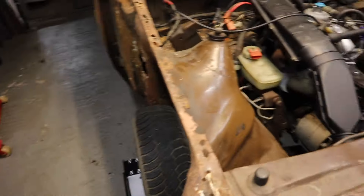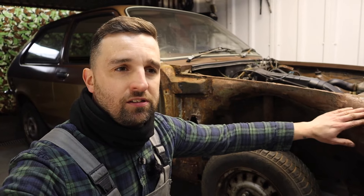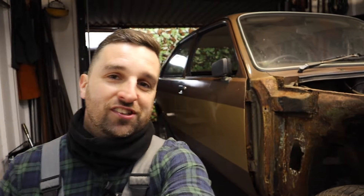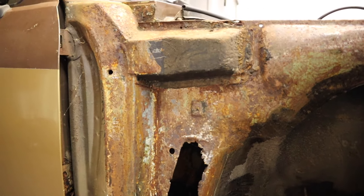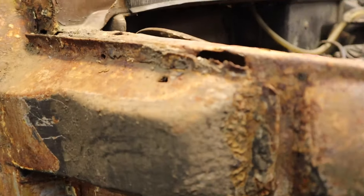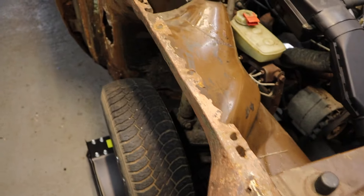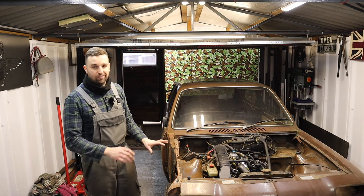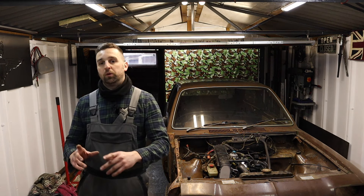Now we did remove this wing. Let's push it over. So we have removed this wing and now this is going to give us a look into what we need to be expecting - and this will be the next upload. So we're onto the fabrication stage now. We've got that corner there which is completely missing, this is plated, it goes all the way around into the arch. We've got the known hole there, this is a bit crusty here, and then this front section is cancerous. We've got this whole lip here as well. I'm literally just going to work on this area continuously until it's done.